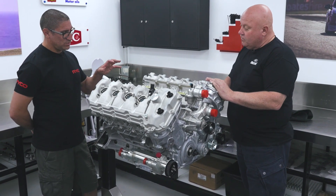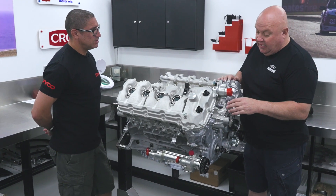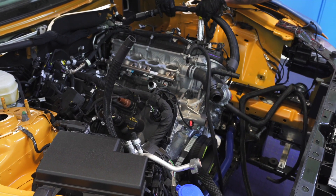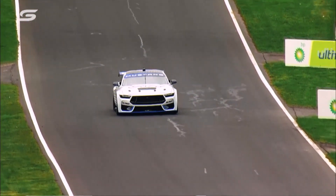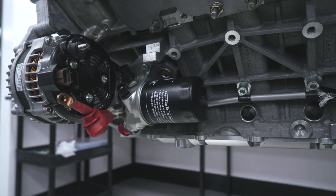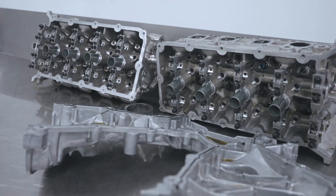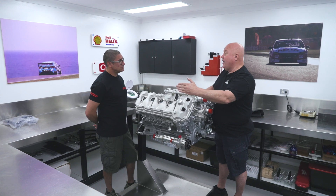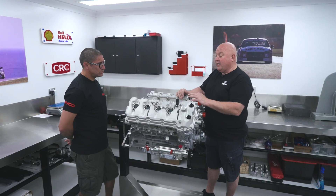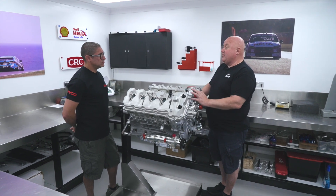For people who don't know — what are the origins and the whole idea of this engine? It's your basic Mustang configuration, the same engine you'd find in a 2023 Mustang. We base it off a 5.2 block. In the US they have the Shelby GT500, which is a supercharged Mustang — we use that block and the CNC cylinder heads from that engine. We run different configuration camshafts, have our own crankshaft made for it, our own rods — it's stroked to 5.4. Mahle make a special piston for it, so it's got a lot of very unique components.